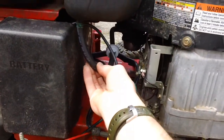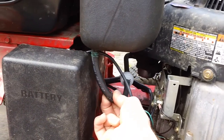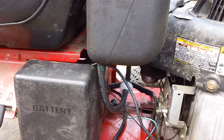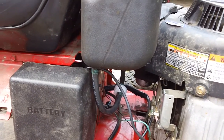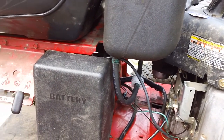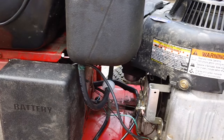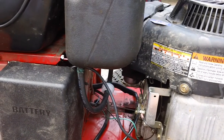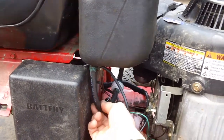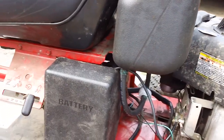You've got your fuel line down here and a fuel filter. We put a new fuel filter on first thing because there was restriction in the fuel line. The owner was trying to do repairs himself and had installed a larger fuel filter off a Kohler machine — one designed for a fuel pump — which wouldn't allow proper flow. You have to have the white disc-type filter on these, which is perfect for the gravity-feed system on a Briggs engine.